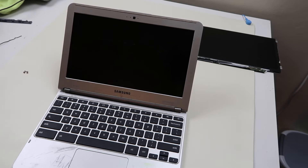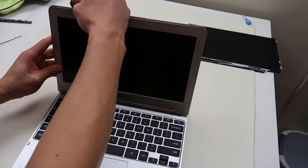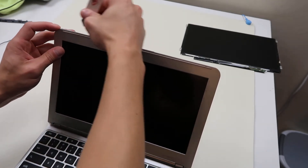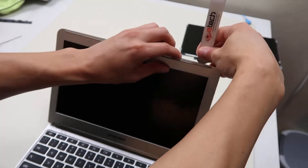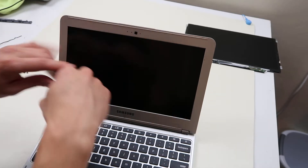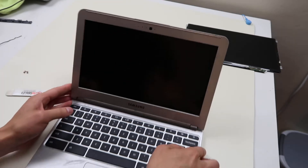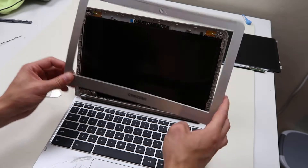These computers are pretty easy — the bezel comes right off. I have a small little metal pry tool here. I'm going to slide it in between the bezel and the rear lid and just go around and pop it off like that. Go nice and slow. This is a little tiny computer — you can definitely muscle this off, but you don't want to. You want to keep as many of those clips whole and unbroken as possible so that when you put the bezel back on, it'll stay. As you can see, it's already cracked there a little bit, so go nice and slow. Take that bezel off like that.